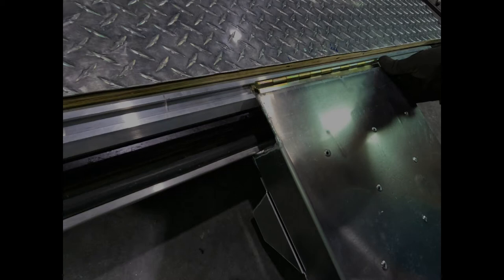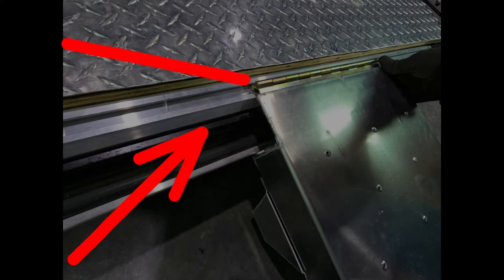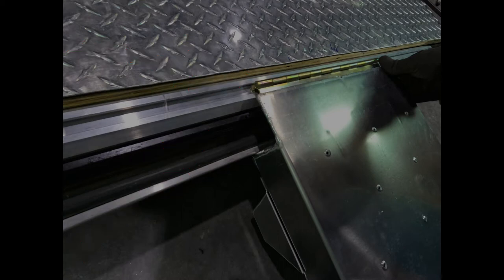This can't be resolved by moving the ramp track further aft, as then it would conflict with the door fully closing. We're going to have to make an add-on piece here. The other issue is that the ramp track to the top of the hinge is about an inch and an eighth, so it creates a speed bump on your ramp. An inch and an eighth may not sound like much, but it might as well be a wheel chock when you're unloading a car out of a trailer with a winch. So we're going to mitigate that as best we can.